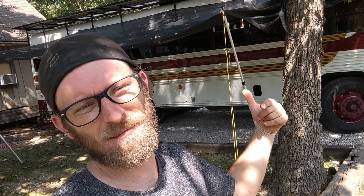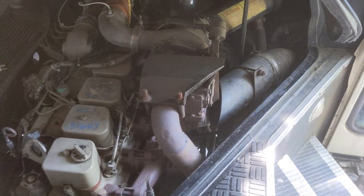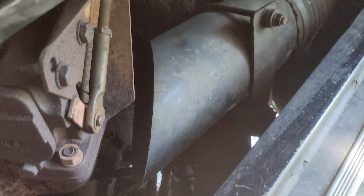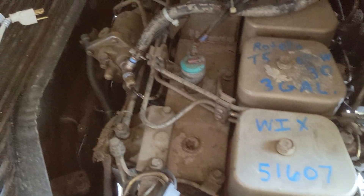I also got attachment points for this awning — there's three of them mounted to the solar rack. The poles from Amazon are telescoping with cables and they just stay. Also some motor modifications: I cut down the fuel plate and added 4,000 RPM governor springs. I turned up the turbo a couple more pounds of boost, and turned up the smoke screws so she chooches a little bit.